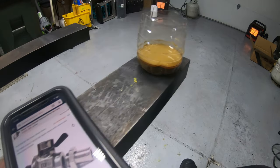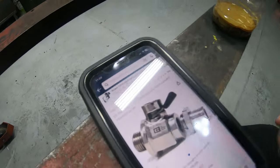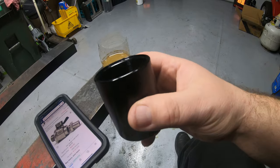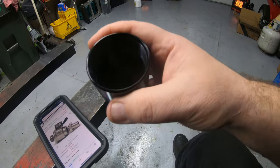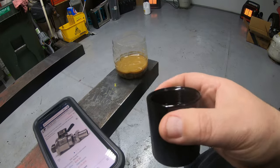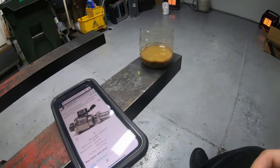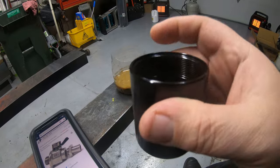While waiting for it to separate, I looked up the EZ 106 14mm drain valve. You can drill and tap the bottom of the can, add a drain valve, and then you don't have to physically remove the can every time — just open it up, catch it in a cut-off water bottle, and dump it. From what I see here, I think I'll need to do this at least every 500 to 600 miles, so about once per tank of fuel. Once the can gets full, it'll just start sucking that fluid right back into your intake.